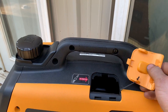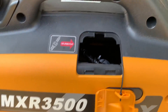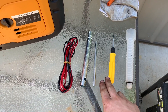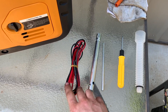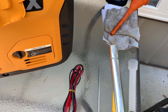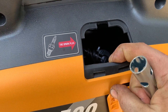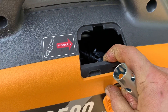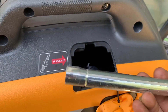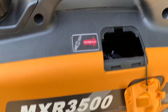You've got your spark plug access — real nice, a lot of room to get to your spark plug. One of my complaints is the tool they give you for the spark plug: when you put it down in there you have to bend the plastic out a little bit before you get square on the plug. I'm not a big fan of that — they should at least notch it. If you just use a regular wrench and an extension it won't interfere, so that's kind of nice.